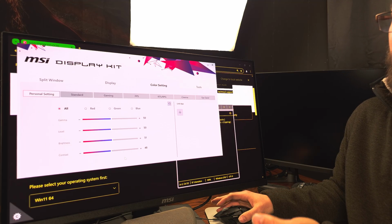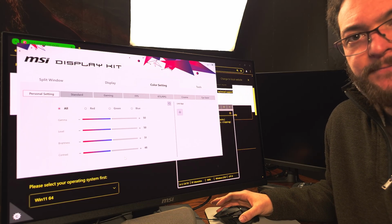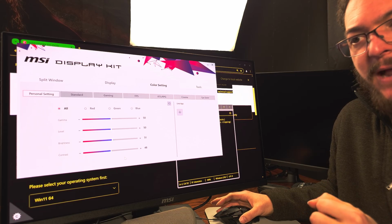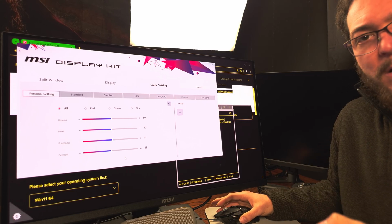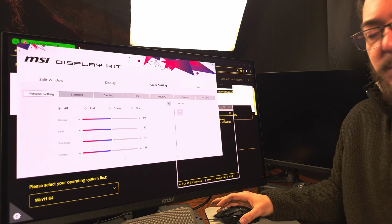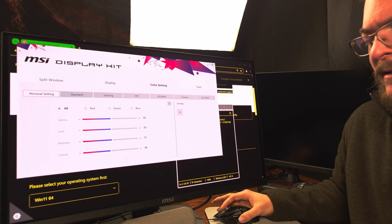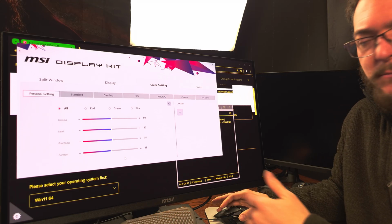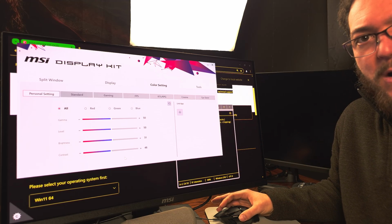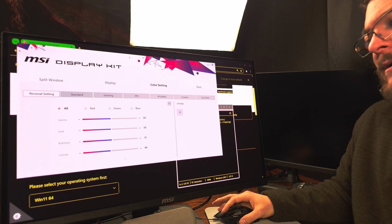I'm going to have a link in the description of the video for you to download some HDR test patterns. Those are videos with near black test patterns, white clipping, color clipping test patterns, uniformity, many HDR test patterns. So that's what I use to do this. Also, the HDR calibration app is a good place. You can just have a black background like I do, and then just check with that. But make sure the lights are off, completely off, so you can have your nose on the screen and make sure that you're not raising the black floor.